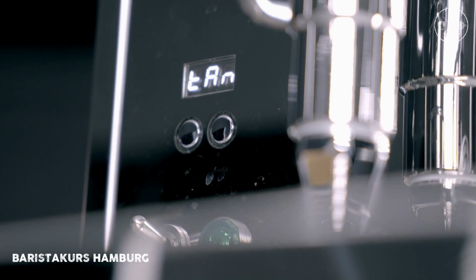And regarding the water tank, we have a little tip. You will certainly clean it from time to time, and you have a small magnet on the side. And this magnet is a float that moves up and down depending on how much water you have in the tank. If it gets a bit misaligned or you don't install it correctly after cleaning, the machine will indicate that it has no water left and it simply won't work. So, just make sure to install this magnet properly.